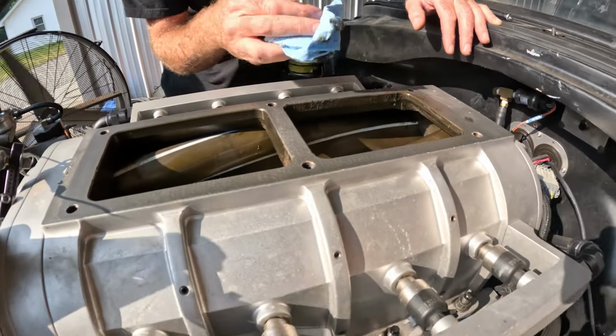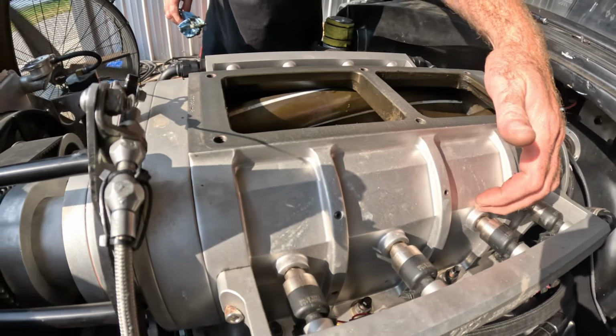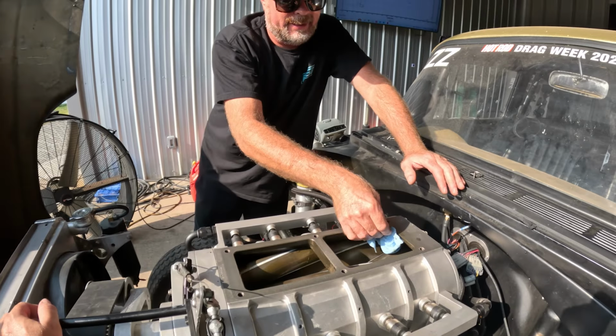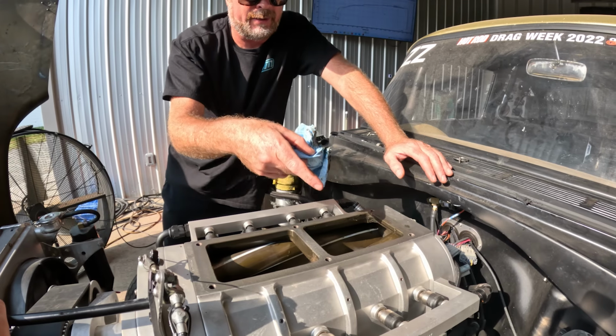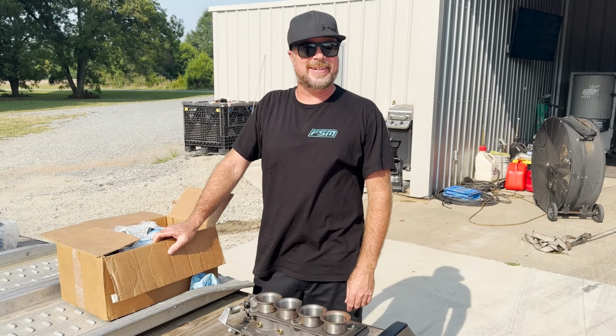It's fuel, probably from reversion. Like the fuel's injected down here on the rotor, and the rotor mixes it and pulls it down in, so I think a lot of what we're seeing in there is fuel. And really the fuel being injected up here is so that the rotors get lubed. I love learning stuff, man.